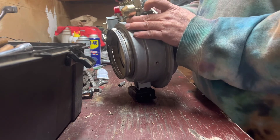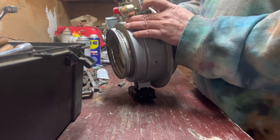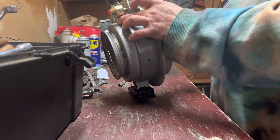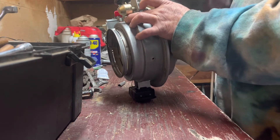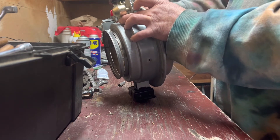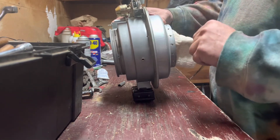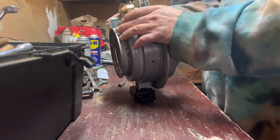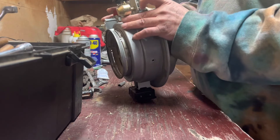I have to raise this wick up all the way and hold it in place. The wick comes up through, but when you drop it down all the way it stays balled up a little bit in this bowl piece — and that's where your kerosene is gonna soak up the most, for easier starting purposes and for running purposes.